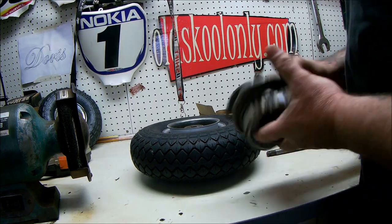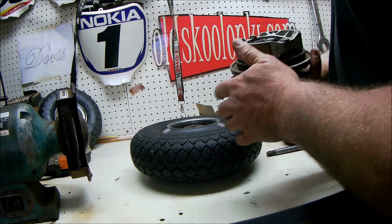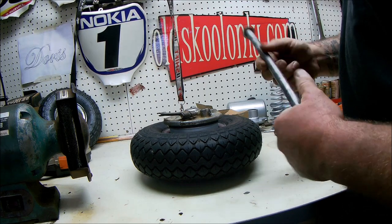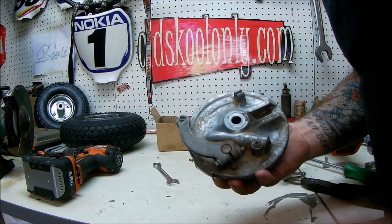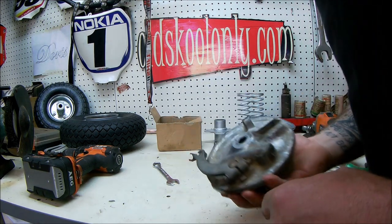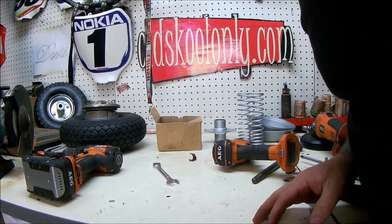All I'm going to do now is run up the hardware, get myself a 15mm drill bit, or as close as I can to 14.8, drill that out, space it up, and then we can stick the back wheel on. I've got to shorten this too. I don't know what this is off, but it's the right size and diameter. Chop the head off, weld a new head on it, and we'll be right. So really, I could show you guys me drilling a hole in this and putting a bolt through that and putting a nut on the end of it, but I know you guys aren't here for that. Let's mix them two straight together and fire that bad boy up.